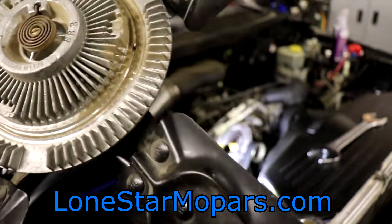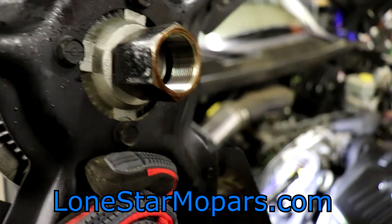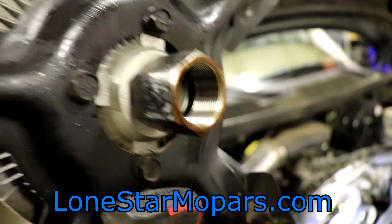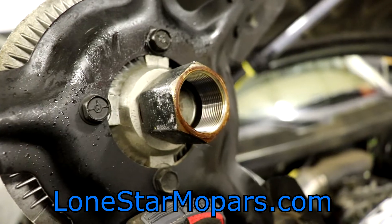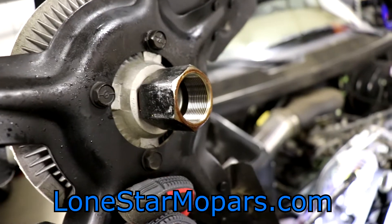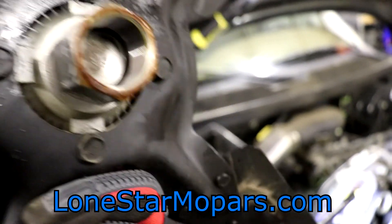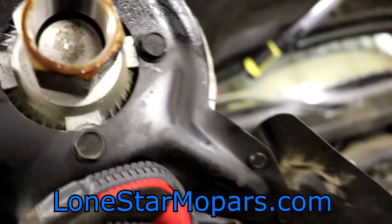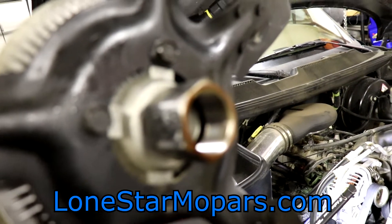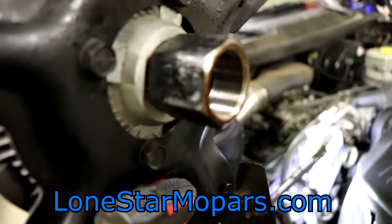This thing is a lot heavier than you'd think — even on old cars I don't remember them being this heavy. It looks to be in pretty good shape even though we did drop it while filming. There is the bane of your existence. You're thinking, take the fan off — well you can't, or rather if you take out these four bolts (I think they're 13-millimeter) all you're going to do is back the fan into the water pump pulley, so that's just going to be a pain.